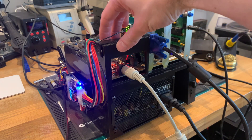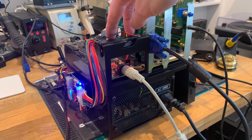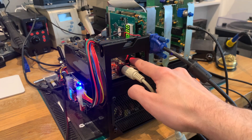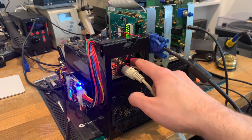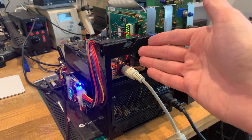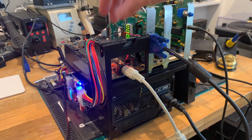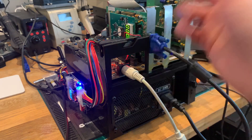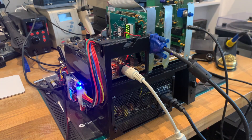Basically you can fetch it from the cupboard or wherever you store it, put it on the table, and run some things. I also attached an external battery — this is an 18650 lithium rechargeable battery attached to the external battery connector. Make sure to check which side is ground. This helps in maintaining the BIOS settings; otherwise you will have to redo them every time you unplug the computer. It fits here very nicely and I attach it with double-sided tape so it's easy to remove.